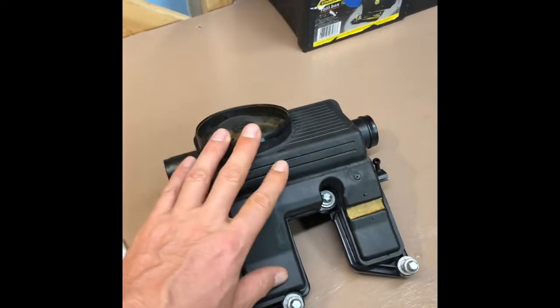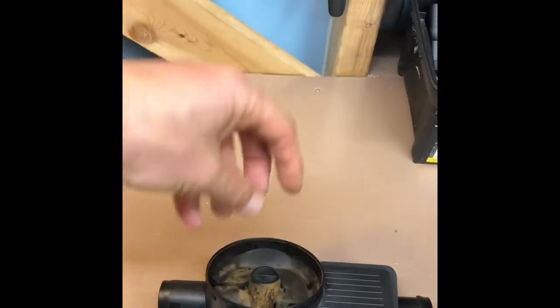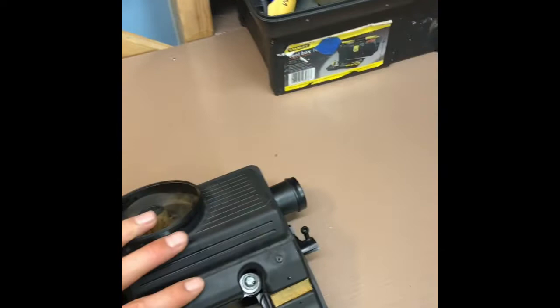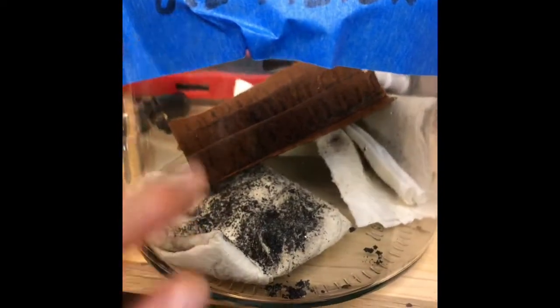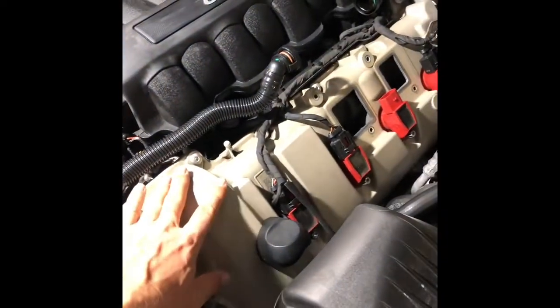So why is it important to clean this? I believe if you don't clean it or never replace it, the return lines from the oil — one side and another side — that oil goes in here and it's drying oil, so it collects all the dirt and everything goes down the engine. You can end up with something like what I was expecting — engine damage. But this came from my filter. It's the same dirt that was collected in that oil separator and around those two holes going on the valve cover.